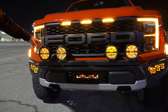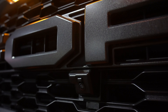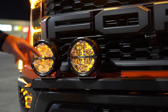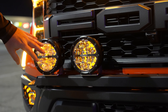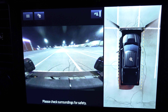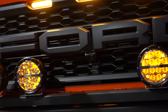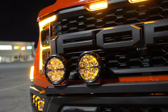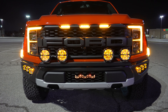These are the larger 360s, and for those concerned about camera blockage, you can see they do come up a little tall. If you put four of these on here, you can actually move them even further out to the outer corners, and you're going to give yourself complete open area for your camera for clearance. This is one nice thing about doing two pairs of the 360 6-inch on that universal cross mount — you can move those to the outside and get yourself nice clearance for that front camera, and still have a very bright set of lights on the front of the truck.